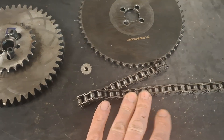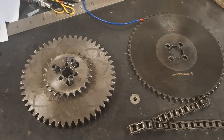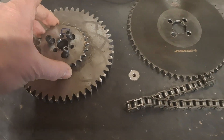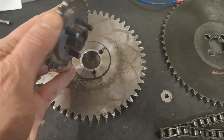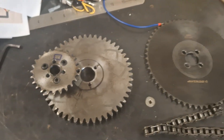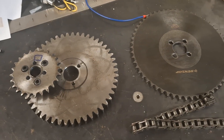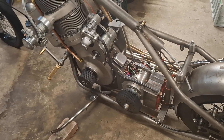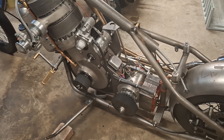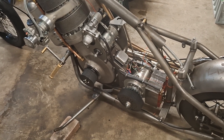Tomorrow I'm going to drag some old chain out and have a play. I've got some half-inch pitch chain, and I've got some duplex chain we used on the timing side to drive the sleeve. The duplex chain is new; the half-inch pitch chain I'll have to buy new, and we need to buy a sprocket with a boss on the back so we can remake the boss with the keyway to fit the dynastart. None of those are particularly difficult jobs — I just want to do it once and not have to worry about it. So that's probably the next job, or perhaps a little bit of electrics depending on what mood I'm in. That's your Friday night update — thank you for watching, more updates will follow.